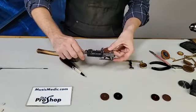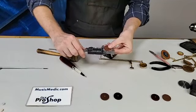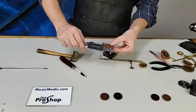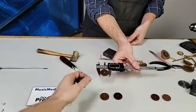Let's see here. Because this is where it gets confusing from an amateur perspective. You get something like 30.06, and is there a tolerance that is going to change that? The answer to that is no. If it's 30.0 and then a tenth of a millimeter, you're within. This one is measuring right around 30.12. Boy, those pads are sized nicely.